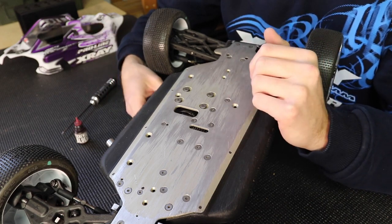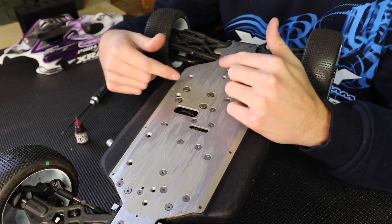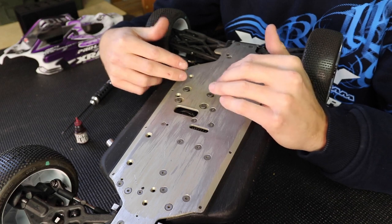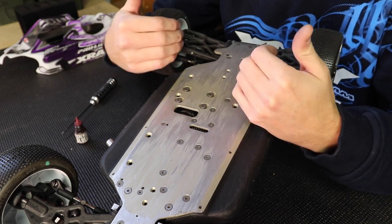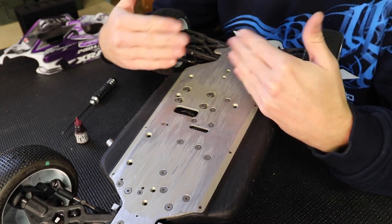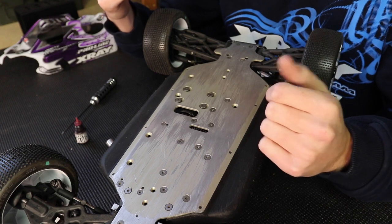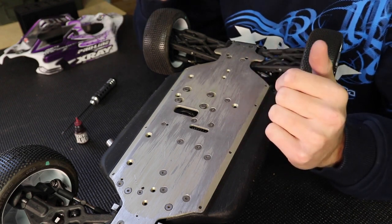But if you have a car like that, make sure there's equal gap between everything. You could even flip it over once you think you've got your mesh set to make sure the engine is straight to the center diff — it just makes your gears wear better if they're straight rather than being at two different angles.